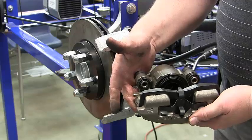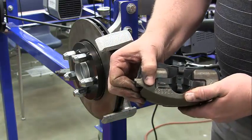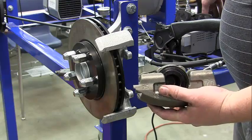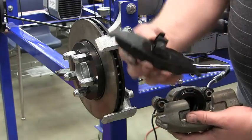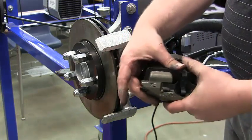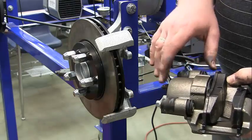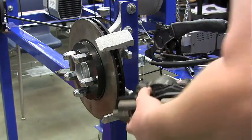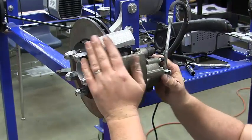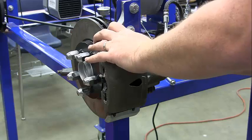Tell me in your notes what I just did wrong — what goes on first? We need to put this one on last. The pad that goes to the inside goes in first — this big one goes inside our piston. The outside pad goes on last and just snaps on. On this particular model, make sure these little pins are pushed all the way in when you put this back on. Start at the bottom, get it in place, and push in. Sometimes the pin sliding guides get in the way, but now we're good. Go ahead and put the pins back in.